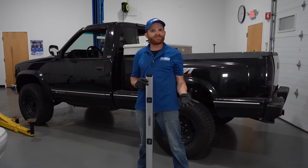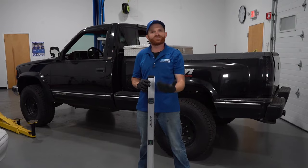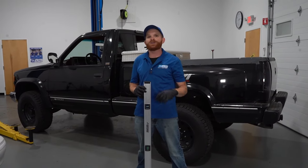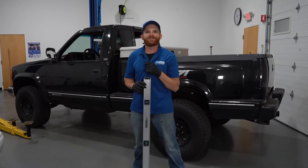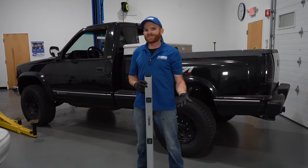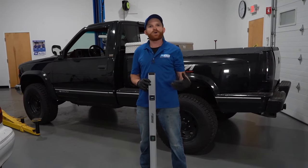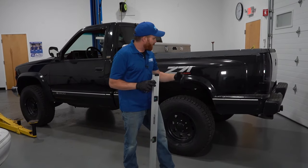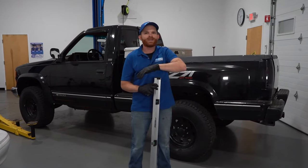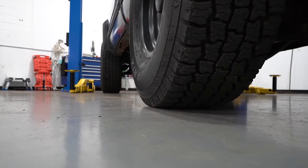It's good for a vehicle to have a little bit of rake. Generally, you want to have more pressure on those front wheels while you're driving down the road. That's going to help ensure that you stay stable, especially while you're steering or even stopping. But if you have too much rake like this one right here, you could potentially skid out if you're driving in a slippery circumstance such as snow or ice. Without enough pressure on the rear wheels because there's too much rake leaning towards the front, there isn't going to be enough traction.